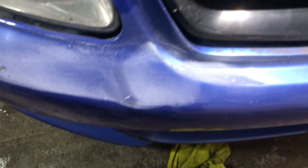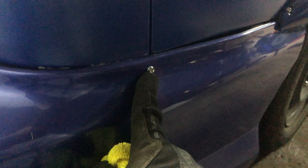Got some spots sanded. I don't need to do any bondo there but I'm gonna do a little bit right there — that should be good. Again, it's not going to be perfect but it's going to be better than the last time I painted it. Got these two parts sanded so I'm about to put a layer there. I'm gonna take this wing off and sand that. The hood's good. The rear bumper is the same way — it's got a bunch of spider webs, can't really see it, it's kind of dark. I'm also thinking about getting different screws and countersinking them just because this is a layover body kit — it literally just goes over the stock bumper.